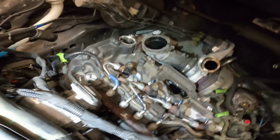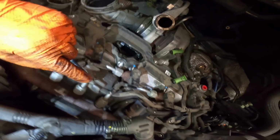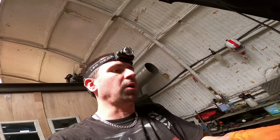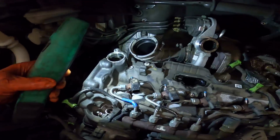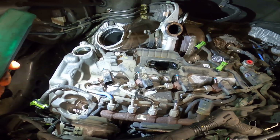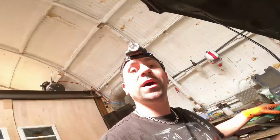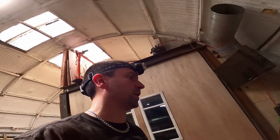So now I have cracked off the high pressure lines. I'm literally going to undo all these ones, undo all them ones, take them off and lay them on the bench. I'm not going to bore you, you know how to take pipes off. If you're watching this video, if you've got this far, you don't really need me to guide you too much. The thing I'm worried about is getting the injectors out, because I know they stick in the head. But I do have an injector puller, so we'll be all right. Right, let's take more stuff off.